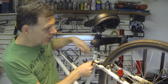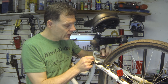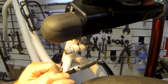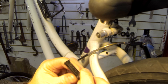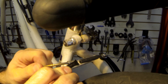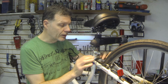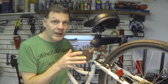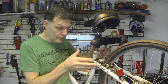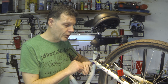One arm has the cable attached to it with a little noodle on it, and usually there's a rubber boot. The rubber boot comes off the end of the noodle. The arm with the little lever on it squeezes together and there's a slot in the top of it — the cable goes through that slot, the noodle inserts there, you put the rubber boot back on, and it's all together. Just knowing how to take this apart and put it back together is a very important step and an easy way to work with your V-brakes on a daily basis when you're taking your wheel off.